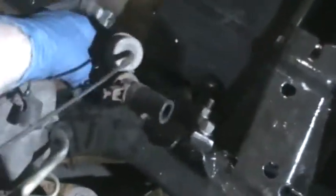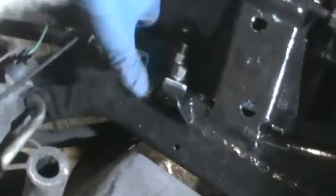I'm going to somehow remove this vacuum hose from the shutoff switch for the heat. It shuts off the hot water going into the heat exchanger. I will either cut that line again because I'm putting new lines on, and I would recommend doing that if you're doing this job, period. But I'll cut that off somehow, make it so that it's not attached to this box anymore.